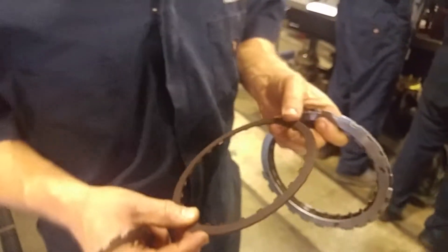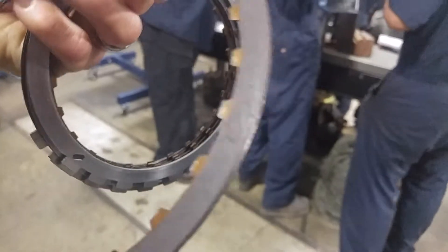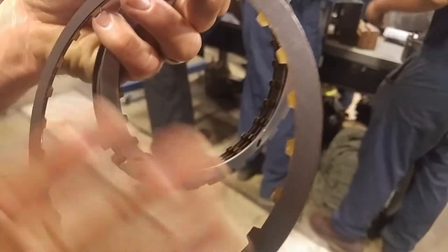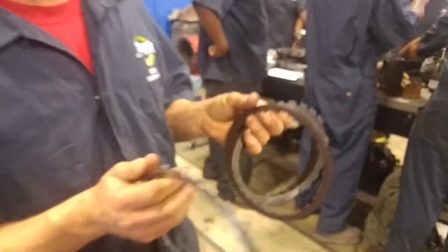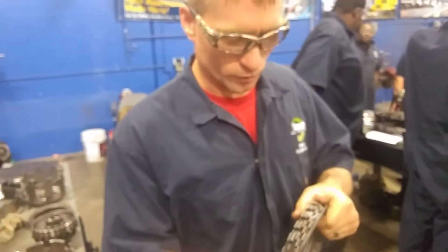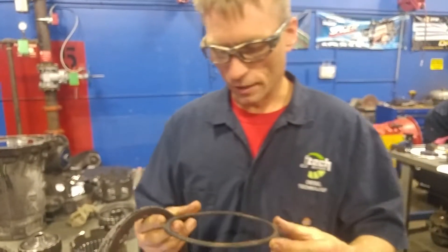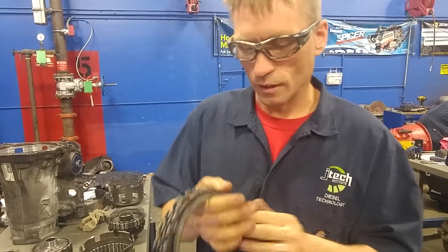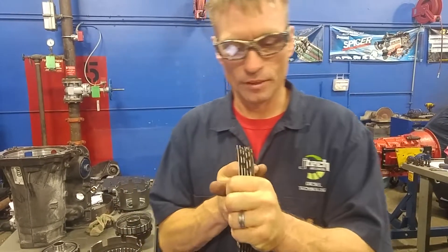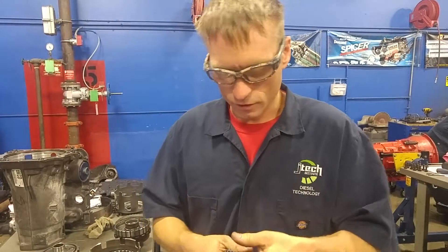These do have it — it's really hard to see, but there are small S's basically in three places around there. That allows fluid to get in between them for cooling and for lubrication while they're free spinning. And then when they're clamped together, that fluid is released and they stick together nice and hard. This wave plate right here is one of the main plates that connects on the outside — it will help hydraulically compress and provide the springing action on the compression and release of the clutch pack.